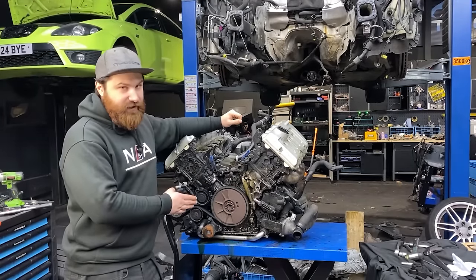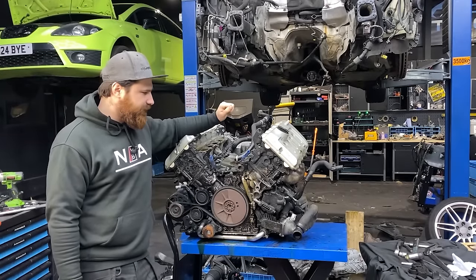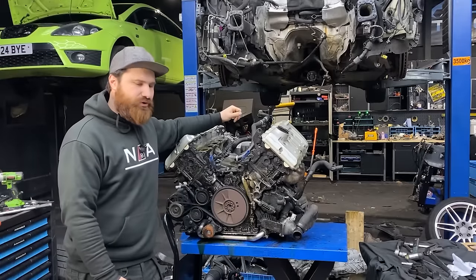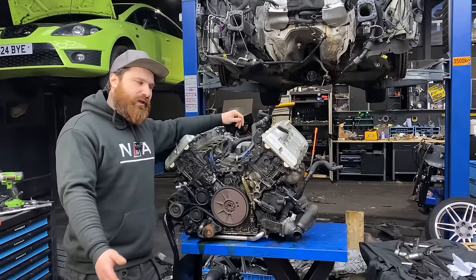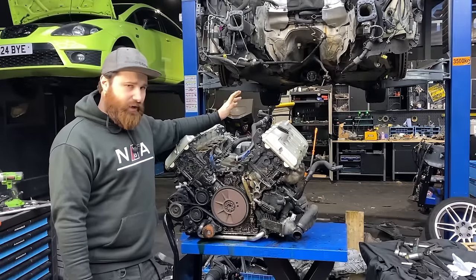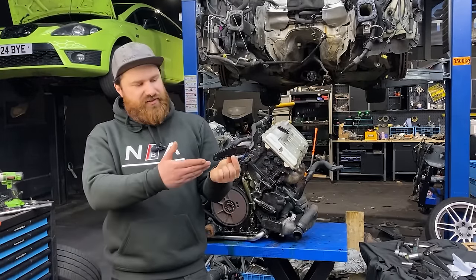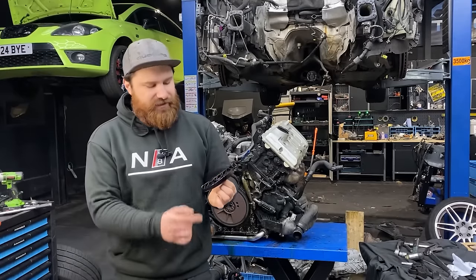And this is what we took out of the car, which I think is not acceptable. Back to the topic — we took the engine out already. All you have to do now is turn it around, take the timing chain covers off, and install the timing chain kit. We're using one from TPS, everything is genuine, like from Audi — all the chains, tensioners and so on. The common fault is if the chains were not done and the guides were not upgraded. This plastic piece used to break — as you can see it's broken here and there's an edge missing.